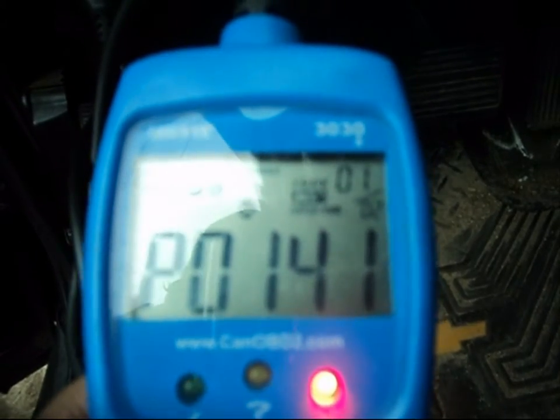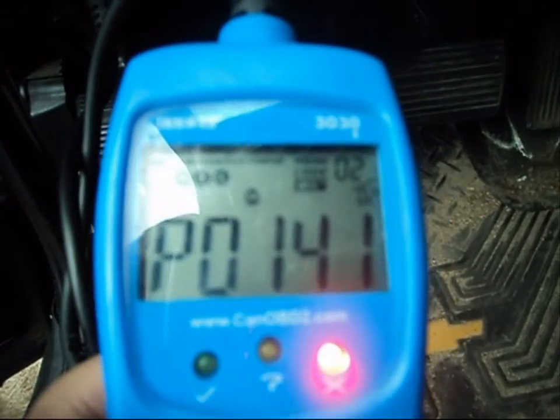We'll cycle through it. It's the same code anyway. For those of you out there, if you get P0141 on your Chevy pickup truck, that means the oxygen sensor bank one sensor two is done. There are four oxygen sensors on this truck. If you take it to a GM dealership, that's $300 for one oxygen sensor. Go to rockauto.com — $40.